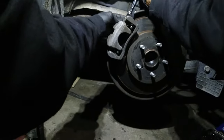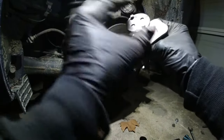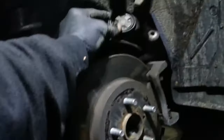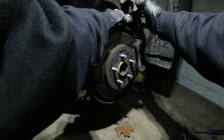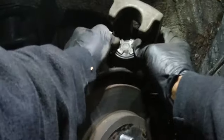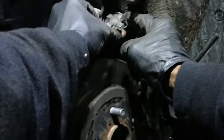Looks good — not crazy tight, but tight. You get a feel for these things after a while. Do the other side. Make sure the little teeth here line up with these indents. That's what you want to do. Turns clockwise on this particular car — it's clockwise on both sides. Some cars are different, but this 2017 Corolla SE with disc brakes in the back is clockwise on both sides. Make sure the boot looks nice and neat because when the backing plate of the pad is resting up against this, you want it to be flush — you don't want to pinch and rip the boot. If you rip the boots, you have to get new calipers.